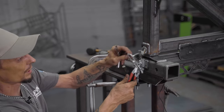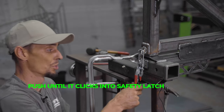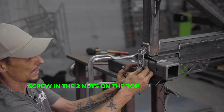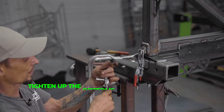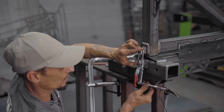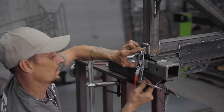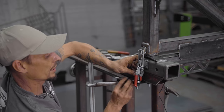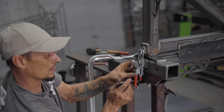This isn't good when we're going down the road with a bunch of weight on the back. The first thing you want to do is latch this thing - you'll notice on the bottom there's a safety latch, push it till it clicks. These two nuts on the top - run those almost all the way down, leave it a little bit loose. Now we're going to tighten up the bottoms. This is all 10-millimeter stuff - it's a lot easier if you have a socket to run the bottoms and a wrench to do the tops.